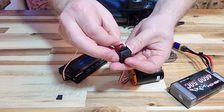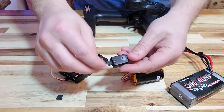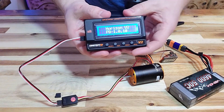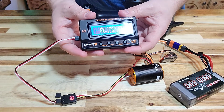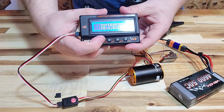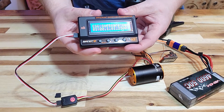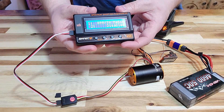The black against the negative, the signal on the loop — the little icon that's there. Once you know you've got it plugged in correctly, we'll turn on the system. That will power up our programming box. This will not connect to the ESC until you hit the Select button — then it will connect to the ESC. It will flash the version of firmware it's currently using before it will let you edit the settings.